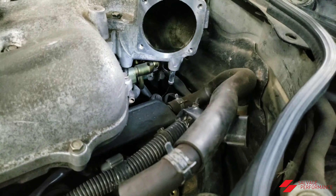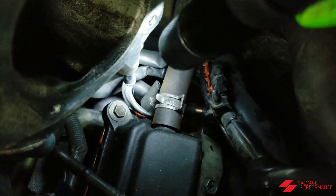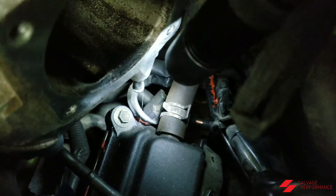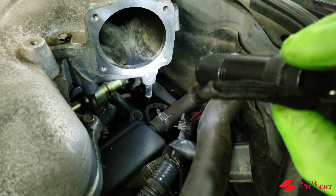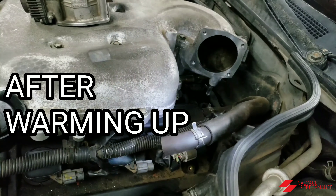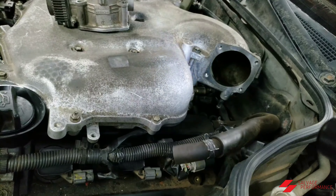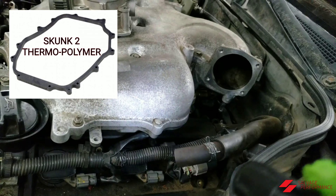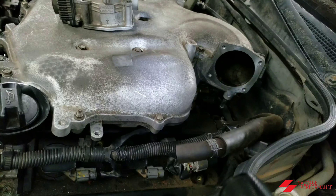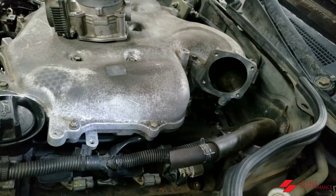What you can do — and the reason why mine are not connected — is because I connected the two of them together. This hose right here with that little brass fitting normally connects right here and the other one normally connects right there. This is just going to bypass going through your intake plenum. The theory behind this is: if you have radiator fluid which is between 180 to 220 degrees, your intake plenum is warming up to those degrees. With the intake plenum spacer, you're trying to divide the heat from the top of the intake plenum and the bottom intake plenum, and that's going to allow you to have cooler air go through your intake and thus create more horsepower.